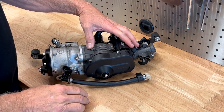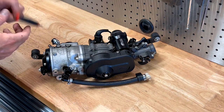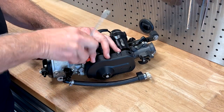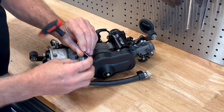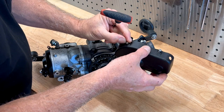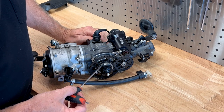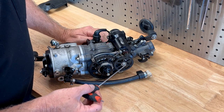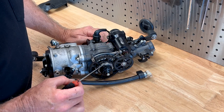Here it is — this is the 100cc DFI. You can see the fuel injection in the transfer port. We're going to get this cover off, get into the clutch, and show you what it's all about. First you need a 2.5mm allen key — pretty simple. We'll just whip that cover off. The good thing about these late model plastic ones is the screws stand proud of the plastic so it all stays in one piece. So inside here you've got what they call the main gear, and inside that is a one-way bearing — we call it a starter clutch, or some people call it a sprag clutch. Then from there we have the idler gear and of course the starter motor and starter motor gear.